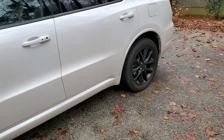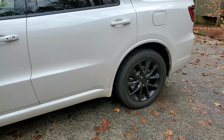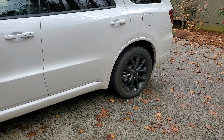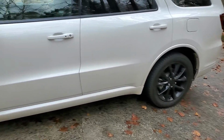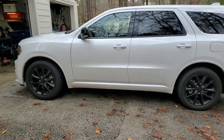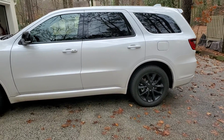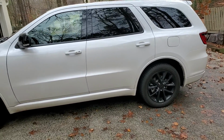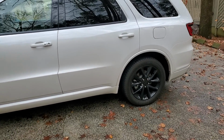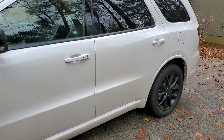That has been the main fix for these check engine light codes relating to emissions or the emissions leak pump. Like I said, I'll put those numbers in the description as well so you can compare to your issue, but not that bad of a job. And hopefully that'll fix your problem. And this could be the same for many different Dodge models, including Durangos and Chargers and Challengers as well. But the location of the pump might be behind the passenger side wheel for some of the Chargers. But for this car, it's behind the driver's side back wheel. And that's all there is to it.